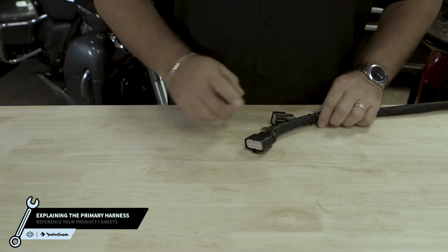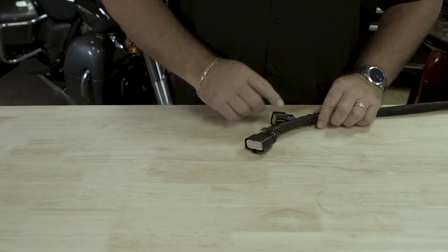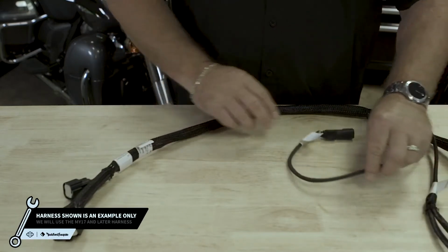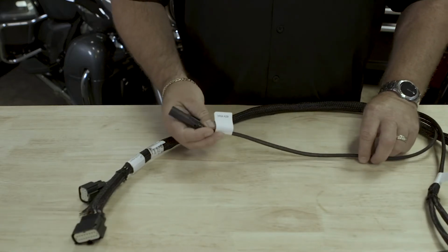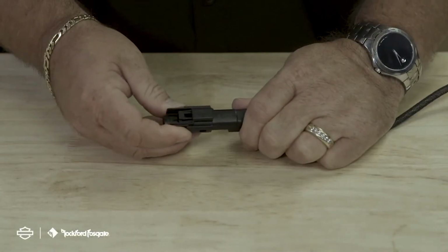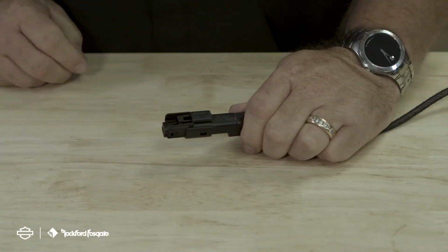Let's take a moment to talk about the primary wiring harness. On one end, you have your 2 connectors that feed through the bulkhead to the primary amplifier. Moving down the cable, you'll have your A to B connector. This is used to connect to your secondary amplifier. If you're running a single amplifier system up to 4 speakers, you will need to install the provided cap cover.